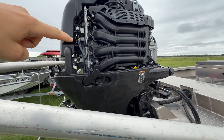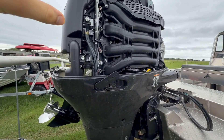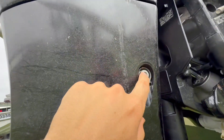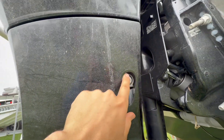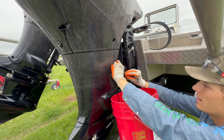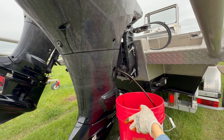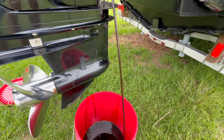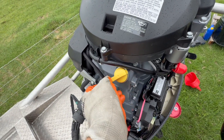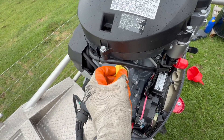To start off you're going to want to take your cover off. If you are near water you could run the engine for a couple minutes before you do the oil change, but in this case I'm just going to change it cold. Down here you got your oil drain plug — put an allen key in there and drain that out first. Make sure you have a bucket ready and there is a washer on there so make sure you catch that. Once the oil is draining, if it's slowing down you can crack open your oil cap and that should help it flow a little bit quicker.